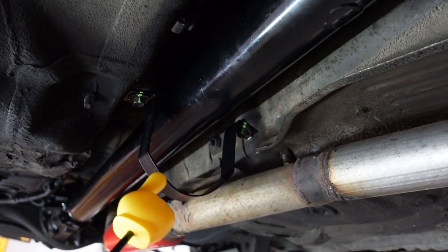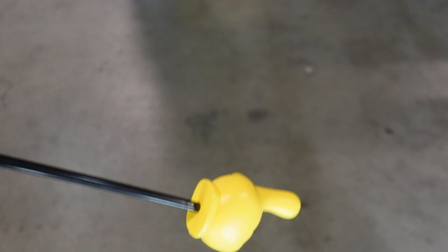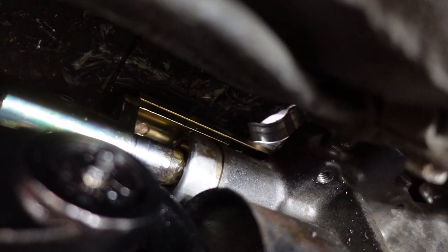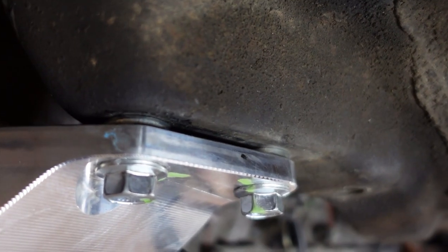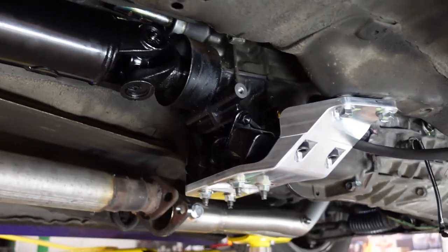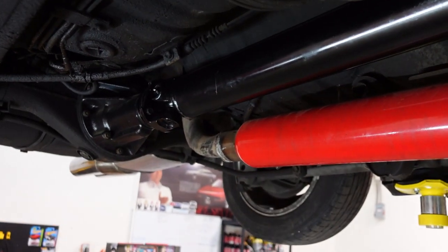With a one-piece driveshaft, you absolutely need a driveshaft safety loop — I'll link the video in the description below. This driveshaft safety loop prevents the driveshaft from going all the way down and catapulting the car. Absolutely required if you have a one-piece driveshaft. You can see the marks where we had to clearance out for the back of the JSP relocation shifter to go into first and third. We ended up spacing the actual transmission mount down about three millimeters, which actually isn't a bad idea — the more you space the transmission mount down, the less extreme the pinion angle gets.